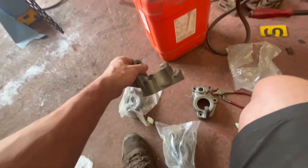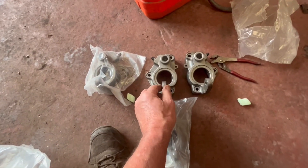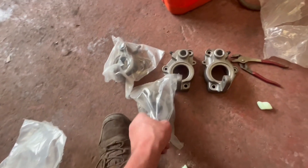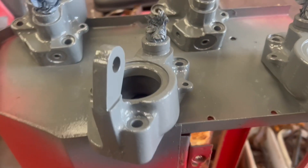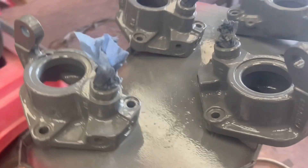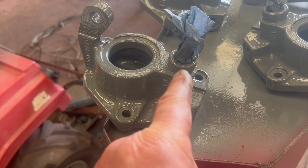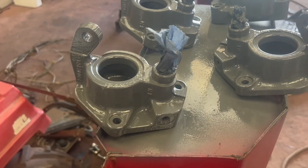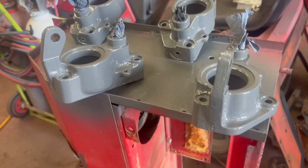We've had a delivery — slave cylinders sent off for that axle and the back one. They've been sorted out, cleaned up, brought out, sleeved — like brand new, all four of them. Happy days. Right, we can get these primed up, get some grey on them, ready to go back on the axle. That's happy Fridays. Just enough grey paint left over from doing the axle, so we've got these primed and painted up, ready for seals — the main oil seals. New pistons and seals are already done. I'm not worried about painting on this because it's going to be shot blasted and cleaned anyway — just a handy place to put them. I'm a happy bunny and hopefully the customer will be too.